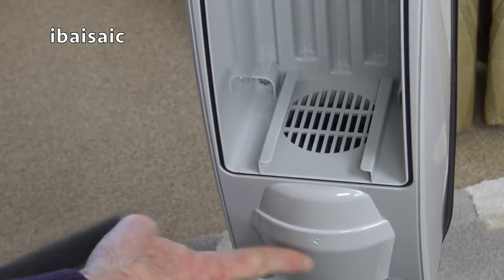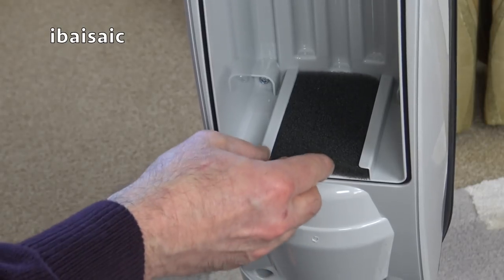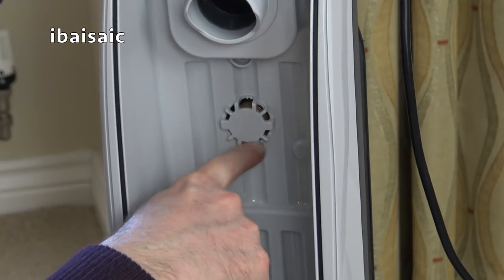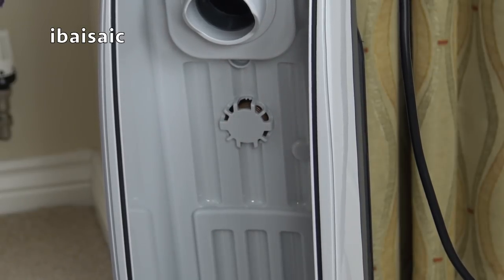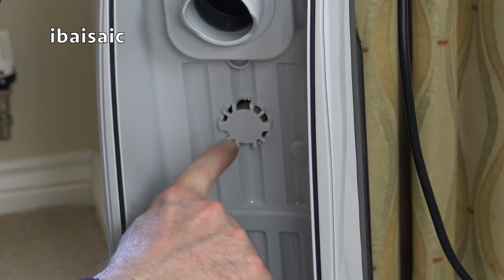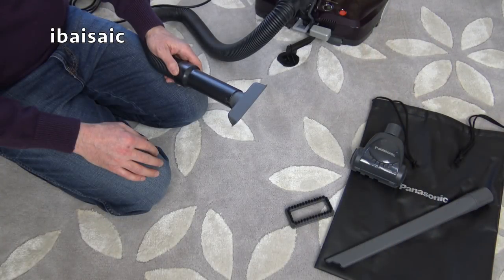The motor is located here. Just above it, Panasonic have provided a suction relief valve — so if there's a blockage or the bag is full, it lets air in. You'll hear it operating, which tells you there's a problem while keeping airflow through to the motor.